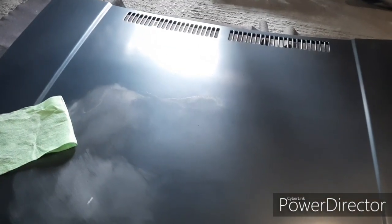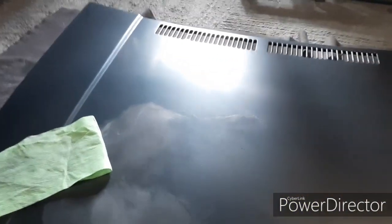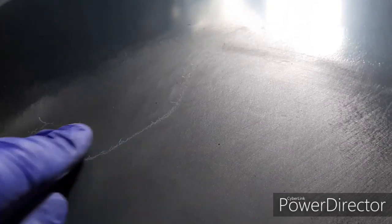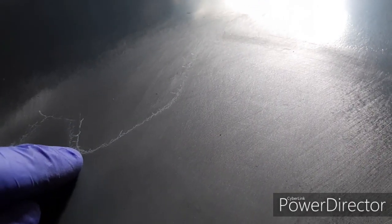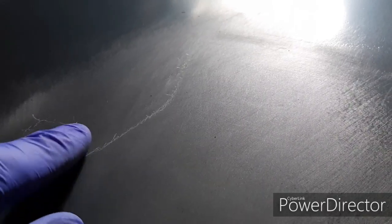This is the bonnet. After a lot of googling, this comes up as wrinkling or cracking. I wasn't happy because on the bonnet I'd put on a thicker coat — getting used to the gun, making a wider spray pattern with a lot more material, getting a nice even base coat — and it wrinkled up within an hour. All the research points to the same thing: it's a chemical reaction. The paint doesn't want to stick to whatever's under it and just rises up.